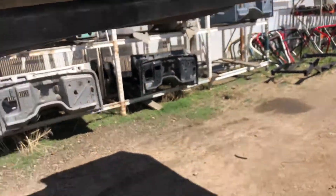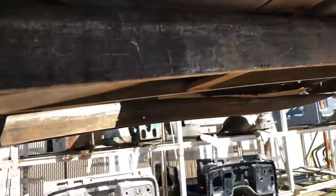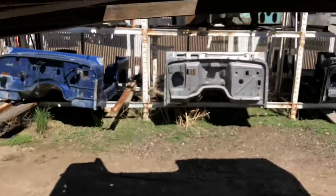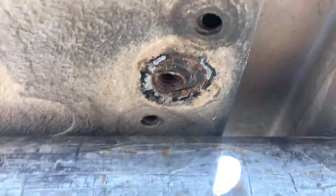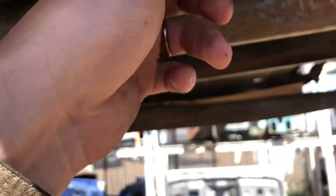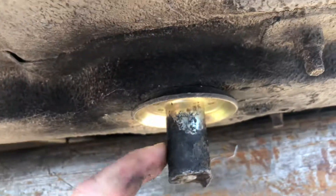What we're looking at here is almost entirely all the frame mounts. That mount there is good — no rot, rust, or anything like that, and you'll be able to screw into it. This one's off — the bushing is gone, and it looks like someone got lazy and cut it, but that's actually better because you can probably get some vice grips and pull that bolt out.